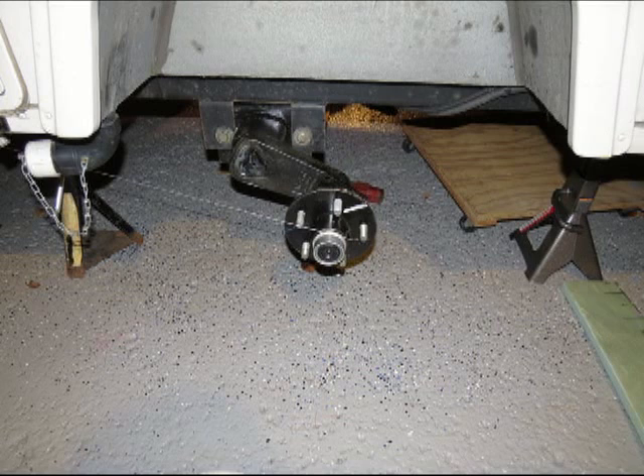At the tongue, the string goes right across the face of the tongue. I put a solid black ink mark on the string at the tongue, and then on each of the axle grease bearing points where the string sits, I put another ink mark with a Sharpie pen. Then I took the string off and looked to see that if I folded the string at the mark I made on the tongue, the other two marks would come up right next to each other. They were within a half a millimeter. So the alignment of the axle was really good — I was very pleased with that.